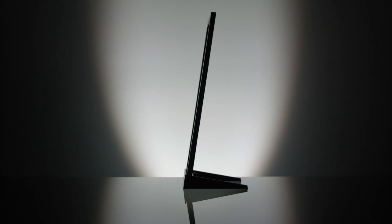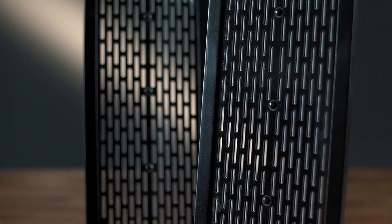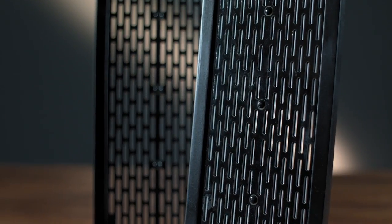The speakers are electrostatic and they have a membrane under tension between two grills. The whole speaker is less than half an inch thick, and the great thing is that they're also transparent. They radiate sound equally out of the front and the back, which means the rear image bounces around the room and gives you that really full expansive sound. Because the membrane is under tension, it moves less than a conventional speaker cone, which means you get half the distortion — and that gives you that high fidelity sound.